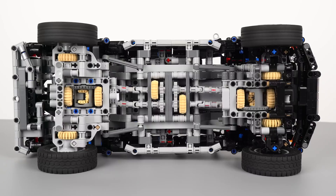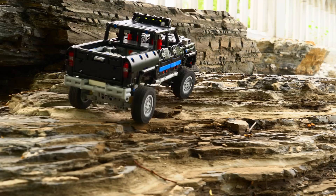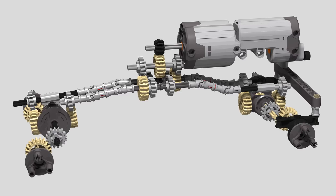That makes an interesting and also unexpected effect while designing it, which is that the two driveshafts on the same axis — going to the rear and to the front respectively — also rotate in opposite directions, no matter how you set up the two differentials. I think that's a bonus point for rock crawling situations. The truck will less likely to roll over.